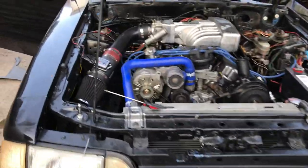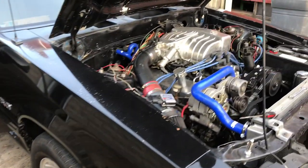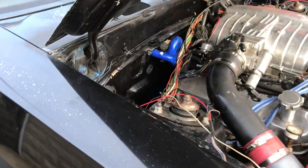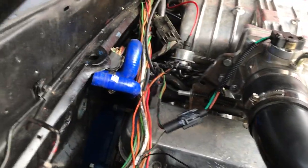I thought I'd make a video about Fox body wiring on 5.0 Mustangs. I've been doing it for a little while and I'll show you what I'm doing here. I don't have an EGR valve anymore — it's gone. I've got a plate back here, so I've eliminated that. I also do not have air conditioning, so I'm removing a lot of the wiring that is unnecessary.